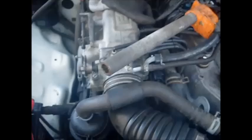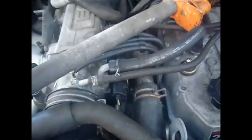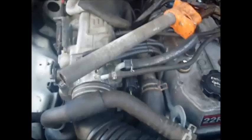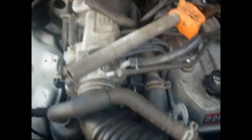The way I checked the pump to see if it was working is I took the line off this end of the fuel filter, which is down in here, and it was still putting out a good amount of liquid. It's just that most of it was water. So I went back and drained the fuel tank just to make sure. Now it seems like the pump is putting just fuel through again, but I want to change that filter anyway.